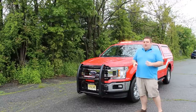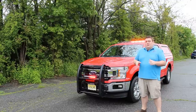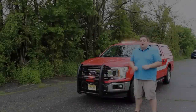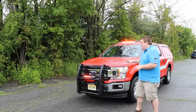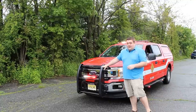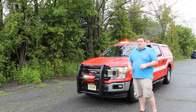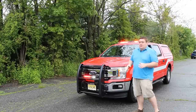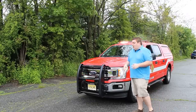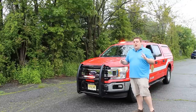The car is currently in park, so all the white flashing lights are off besides the hideaways. With the vehicle in drive or response mode, you can see we've added flashing white into the light bar, white into the front stick, and white into the side mirror lights. We've also changed up the pattern in the light bar to provide a more functional response mode. One thing you'll notice is that when the vehicle is in park, all the patterns are synced, ensuring full vehicle coverage while responding.